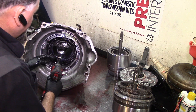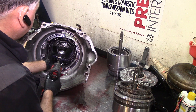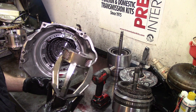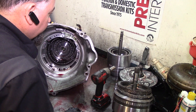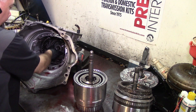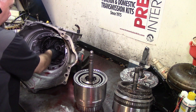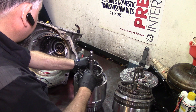I had to put my jaw puller here with a socket — and there we go. I got the planet out. The splines are all right. The planet looks good, looks a little bit overheated for some reason. This goes in here, and this is the bearing I was talking about — it has a fiber washer, and the fiber washer looks in good shape.